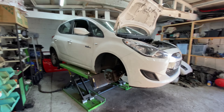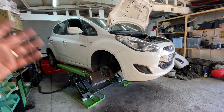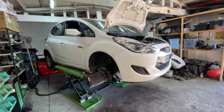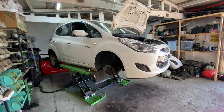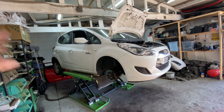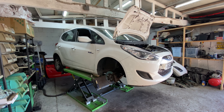Yeah, that is what we've got to replace. It is what it is. I don't think these can be expensive - it's only a small little subframe, look at it, it's tiny. So that's our damage guys. Discs and pads are really good, all in good condition, loads of tread on the pads - actually I might do the pads as well. So the plan is: pads, service, subframe, clean. And that's kind of it - that's the car done.